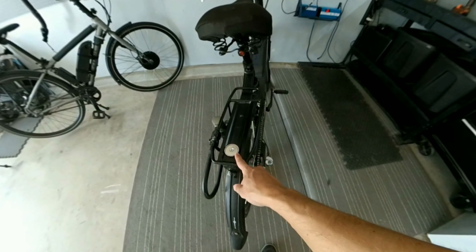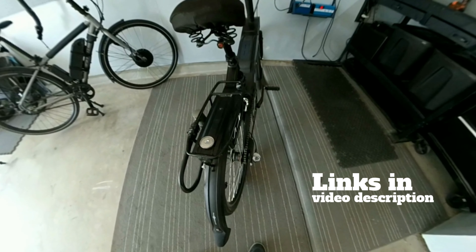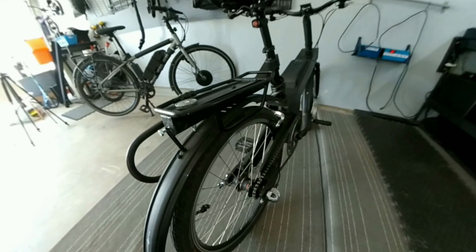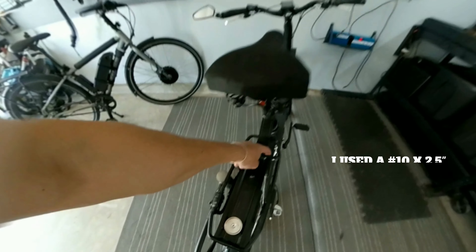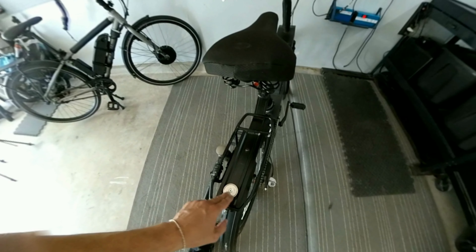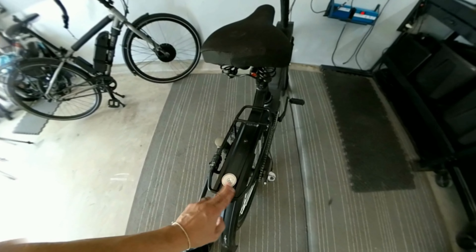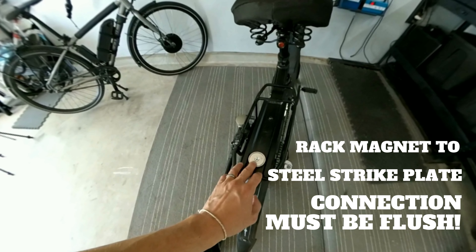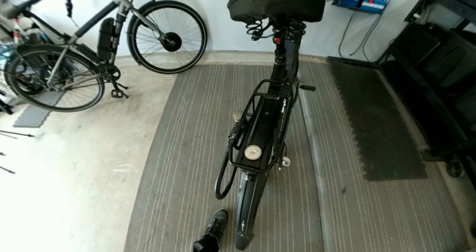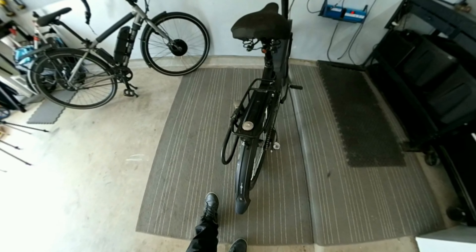The hardest part about bike commuting or car replacement is figuring out what to do with your cargo, so we really need to keep this as simple and convenient as possible. The main premise is that this is a 1.5 inch neodymium cup magnet — I think it's either 0.2 or 0.3 inches thick — and I just bolted it directly onto the rack, so that's semi-permanently on there. The J-hooks just hook around here, and you have a strike plate on whatever bag or basket you're trying to attach. As long as the strike plate is steel and it's touching the magnet, you have a nice solid connection. These are really strong magnets — I think this is a 90 or 95 pound pull force — and you can just feel it; it's not going anywhere when it's on there.